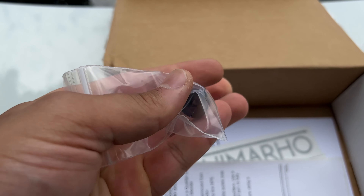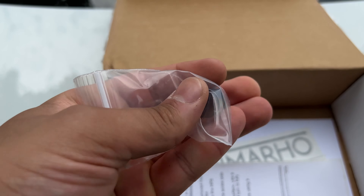What I had to do was drill it out, and you have to be super careful not to let any plastic go down inside the expansion tank. So just avoid the situation in total. When I did have this go bad, I got a replacement plastic one for like five or six bucks off Amazon. That did work and resolved my issue, but given that the last one broke, I figured this time I should upgrade it to a metal one.